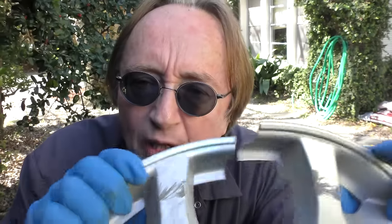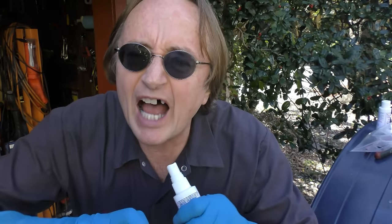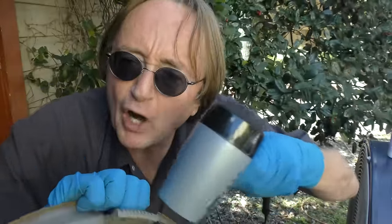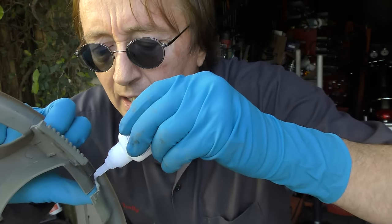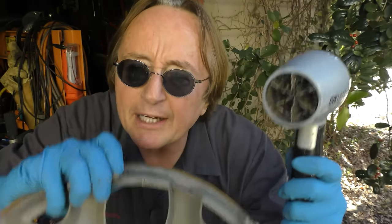It works really well on broken plastic parts, though they're a little more complicated. You get the polyprop spray and spray both sides of the crack, saturate them, then let them dry. Then get the activator accelerator and spray only one side, let that dry. Then get a hair dryer and heat both sides for 30-40 seconds to make them more pliable. Then get the S1 blue and put it on the opposite side from where you put the activator. Cover it all up, then push it together and hold for about 30 seconds, wiping off any excess. Then heat it up with the hair dryer another 30 seconds.